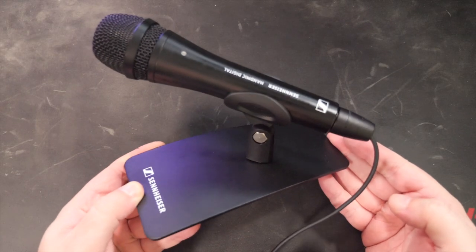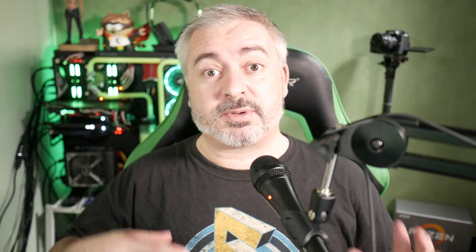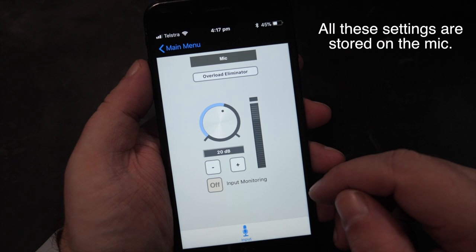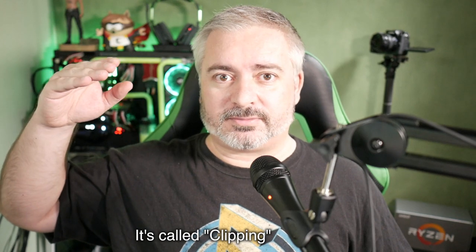I'll show you that when I show you the footage I'm going to take when I'm out and about. When this thing is plugged into your phone, you can load up an app from Apogee — a company that Sennheiser have partnered with for this product. They built the onboard digital audio converter or the onboard preamp, or both. Some of the technology in there is from Apogee, which means it works with their app, so you can fiddle with things like gain, rumble rejection, and the limiter. That's one of the most amazing things about this microphone and they don't really advertise it — it's like a secret feature. It has an onboard limiter: when you get too loud into a microphone and it distorts, this technology lowers the sensitivity automatically to stop that distortion happening. And you can adjust how much that limiter affects things to fine tune it, which makes this an incredibly powerful tool.